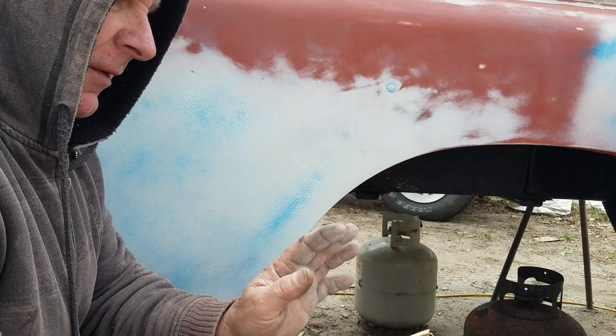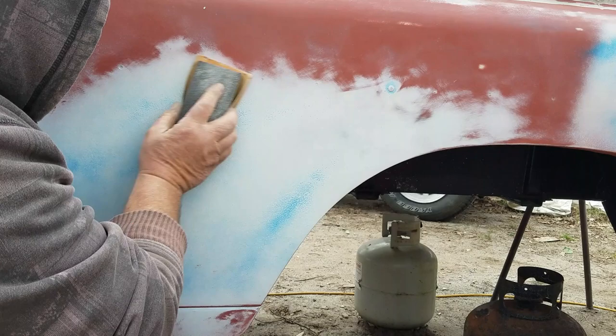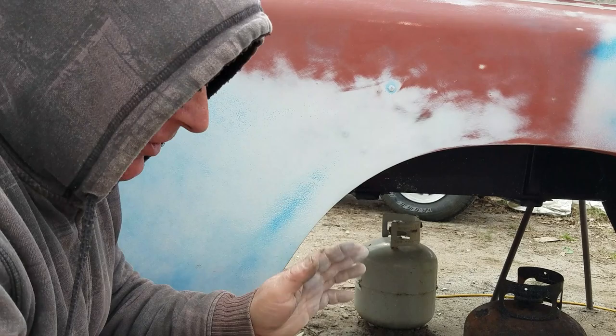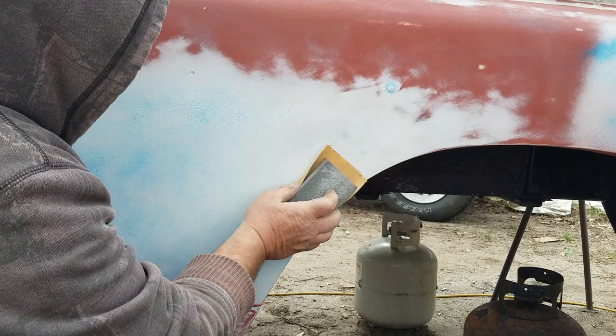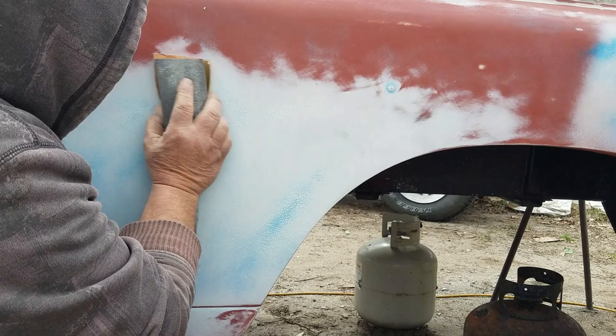Good car paint is expensive, but I guess this is the reason you pay big dollars for a good paint job — it's the preparation time that goes into it. I spent the rest of the day blocking it back, tidying up around rivet heads, and preparing some of the small parts to paint.